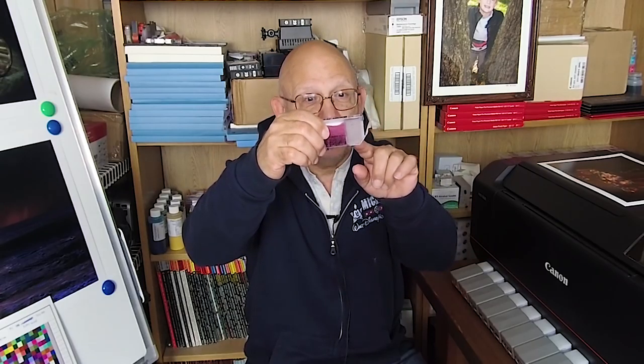The Canon Pro 100 can do that as well. People are very worried about the chip misrepresenting ink levels. There is no way — except maybe for the Pro 1000 — for a printer in the category of the Pro 10, Pro 1, or Pro 100 to actually measure actual droplets of ink. It is going to estimate, and that estimation is sent to the chip, which begins to count down in increments.